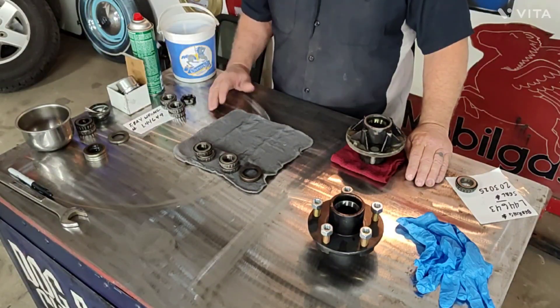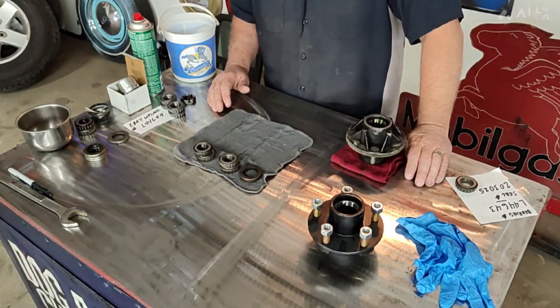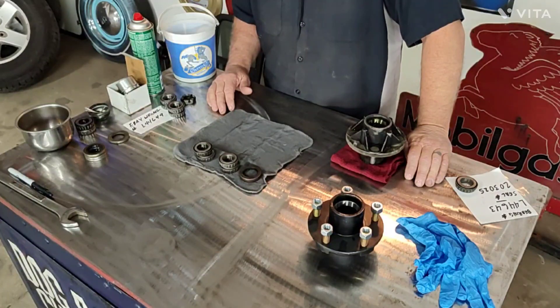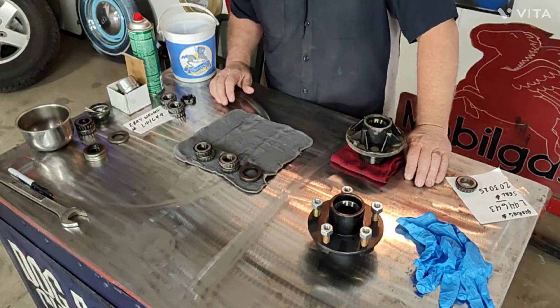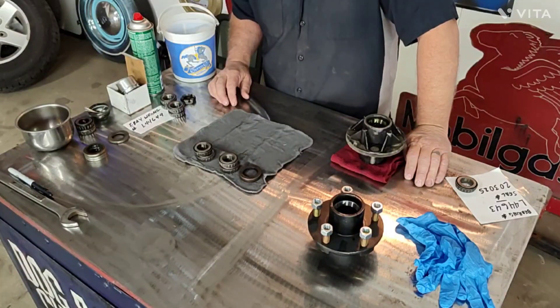You can go up to 3,500 pounds - you can get them readily available in any width. It's not necessary on a smaller teardrop, but I've seen it done. If you're going to do some serious rock crawling and go with a crazy suspension on your square drop and want to haul extra tires, fuel and stuff in it, sure, run a big heavy axle. For most of us weekend campers, we're going to do the 2,000 pound axle.